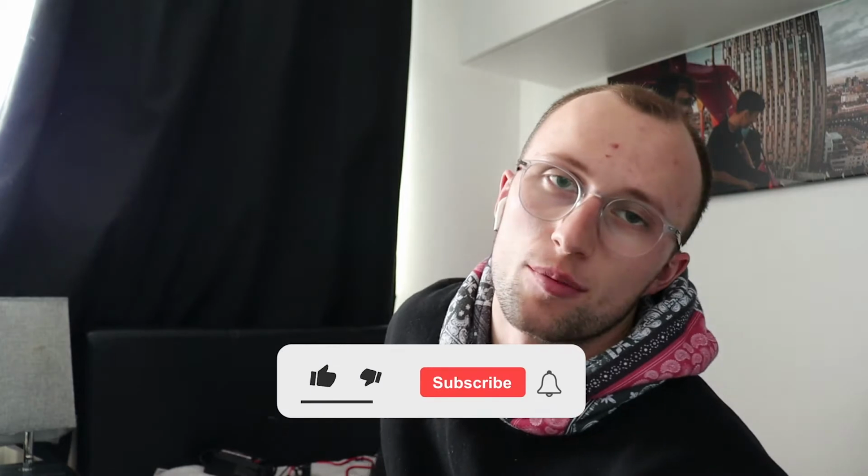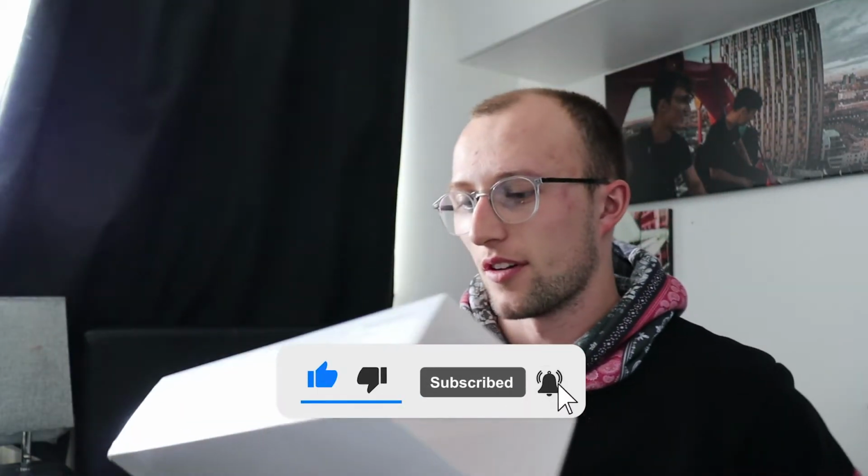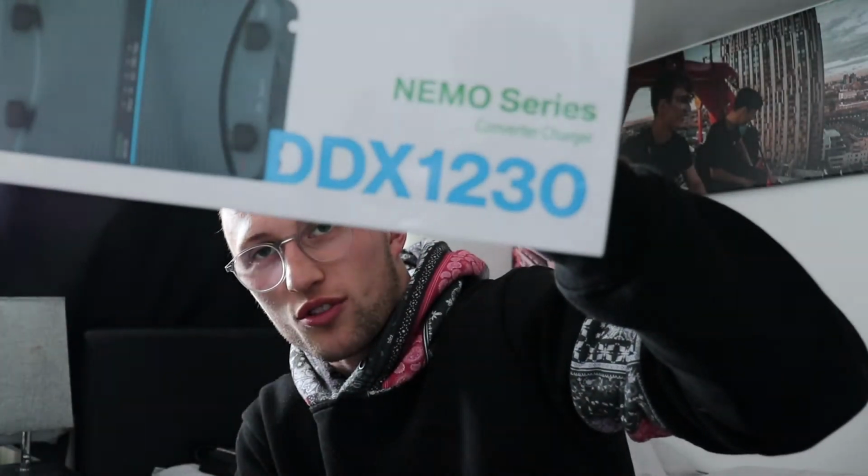Today we'll be connecting up a battery to battery charger. Nemo series converter charger DDX1230. Let's run the ignition wire. We'll have to extend it all the way down from where the electrics are to the fuse box, so that I can piggyback fuse it onto an ignition live.